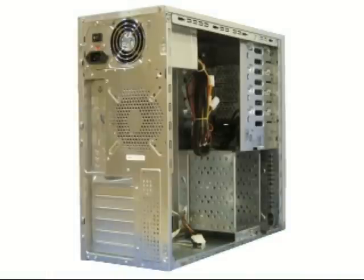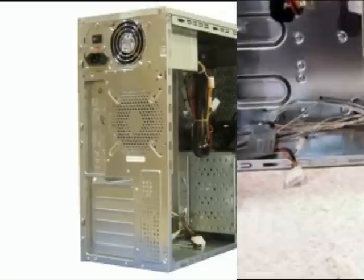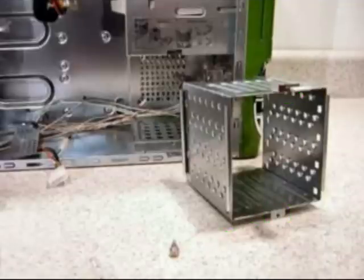Because only the top 3 5 1/4 drive bays would be populated, I opted to relocate the drive cage up here on this platform where the floppy drive bay initially resided. Because I had no floppy drive, who still does really, I didn't hesitate to give it the boot. The hard drive cage is removable, which made its relocation easier. You simply remove the thumb screw at its base, press on the tab at the top, and it slides right out.